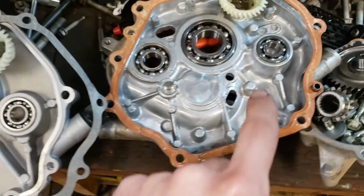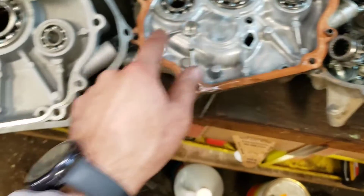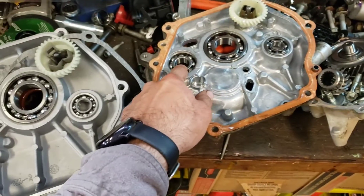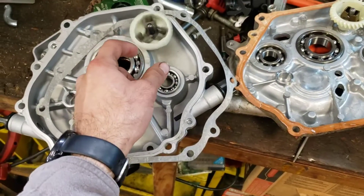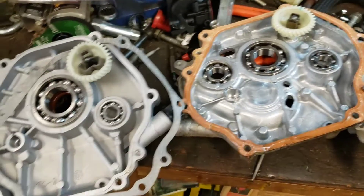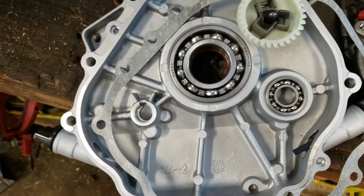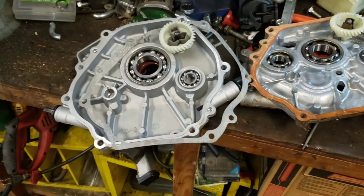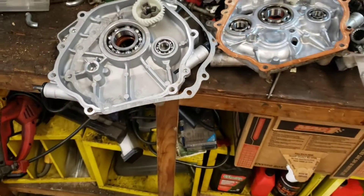You can see here - instead of a through hole - actually the counterbalance support is not a through hole, so those are identical. But here we had a through hole where one of the gears on the reduction rode, and that's now non-existent. We've got the same support for the camshaft, we get a new governor gear, and it's actually a little different - it's got three weights instead of two. I've never seen a three-weight governor gear before, interesting. There's a new bearing here that looks a little beefier. I hope the diameters are the same - that actually looks bigger - so we may need to swap some bearings. And then there's a seal where we didn't have one before. Let me do some measuring and I'll give you an update in a second.